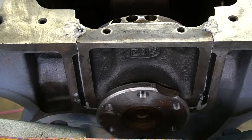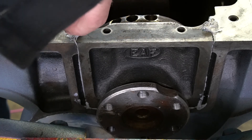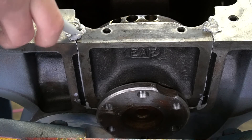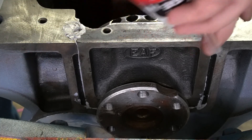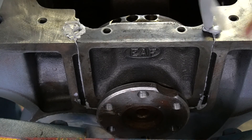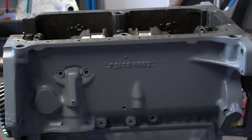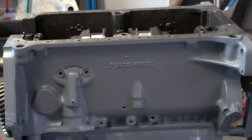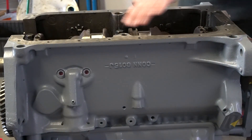It's done that on both sides. Now I'm going to take more RTV with the nozzle and just stick it down in there and pump it. Now it's pushed more out and we're filled to the top. We'll do the same thing on both sides. So now that our rear main seal and rear main cap is installed, I now need to torque down everything.